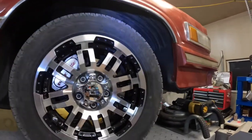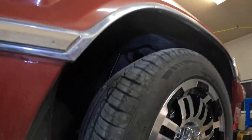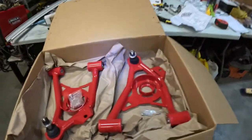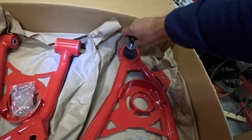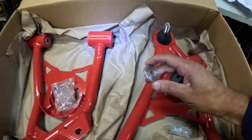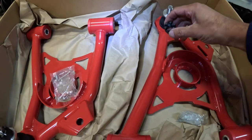The brakes are broken in now so I can retest. I just wanted to make a little update video since I haven't posted in a while. There's the strut in there - nice rotors. The camber/caster plates are in there. Notice they also gave us a little spacer - they also have a machined spacer that they supply with this kit. It's probably almost the exact same thickness as the one I machined. That's the ball joint - they also gave me a new castellated nut, which is nice.